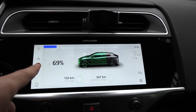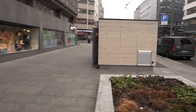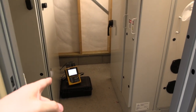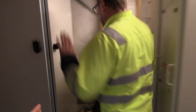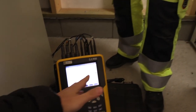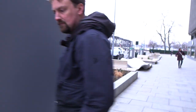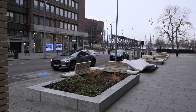This car has been fitted with a wireless charging pad. We will start from 70% — we'll charge it up to 70% and then do the test. Over here we have all the electronics, and this device measures the energy that goes from the grid. We're measuring what actually goes from the grid, and then we will see how many kilowatt hours we spend. Afterwards we will do the conductive charging with the cable and see how many kilowatt hours we spend, so we can estimate the efficiency.